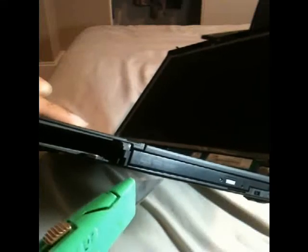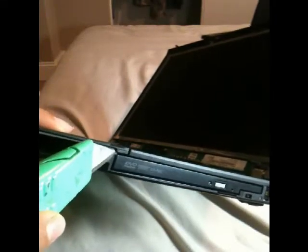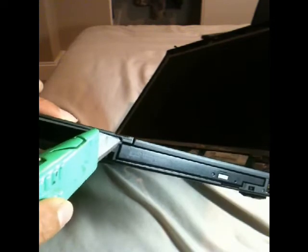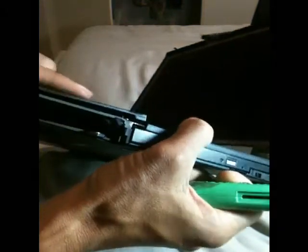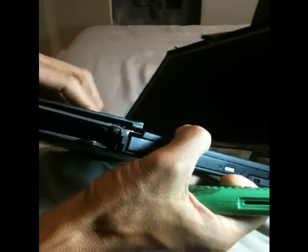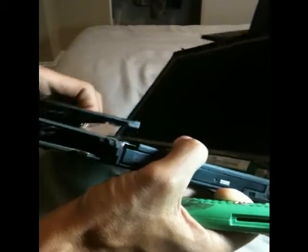I will show you how to dislodge locking tabs of the mousepad board. First, position the laptop at a 45 degree angle, then using a box cutter, pry this tab outwards. Then going from right to left, slowly pull towards you a little, then pull up a little.